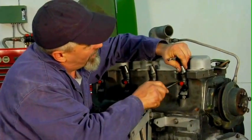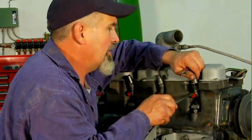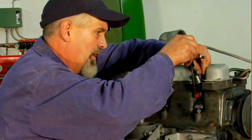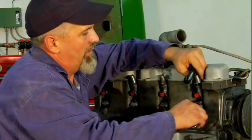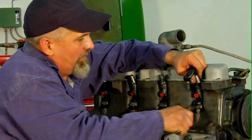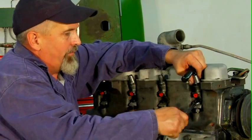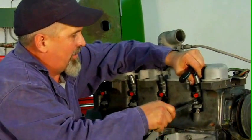Take something and rotate the injector around so that it's straight, so that the flat surface here where the fuel line matches up will match the surface of the line itself. I'll get a lot better seal between the fuel line and the injector in that way.